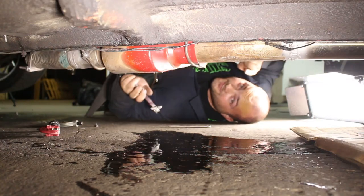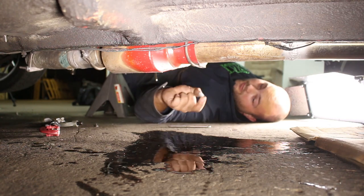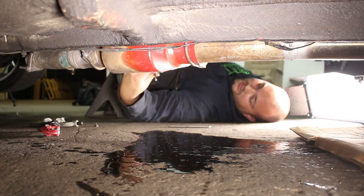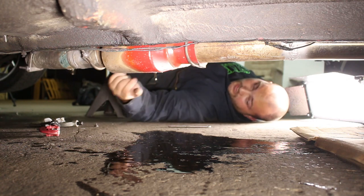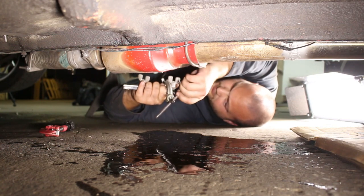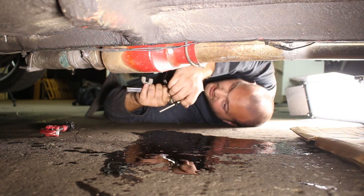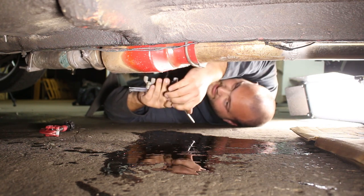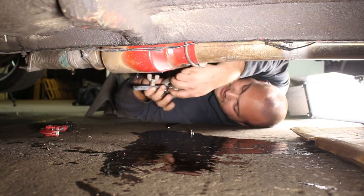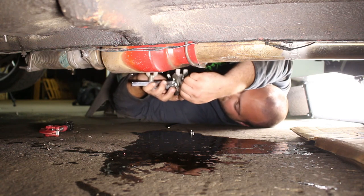You wanna know a really annoying fact about flaring brake line? The best flare that you can do is one where you forget to put the fitting on before you flare it. Every single time, it's the best one. But I have to redo it, and it never turns out as good. Talk about annoying. I think I actually did a video with Mark on how to flare brake line. So if you don't know how and you wanna know, I'll try to put a link in the description or right here on our video on how to flare brake line. There you go. So we flared it once, now we gotta flare it again. That's why it's called a double flare brake line.